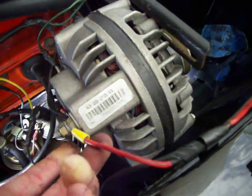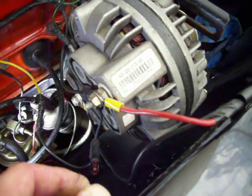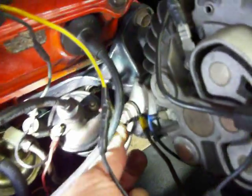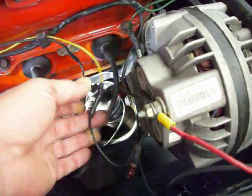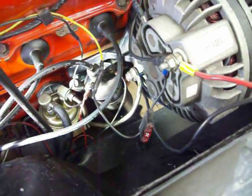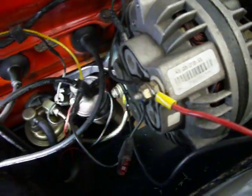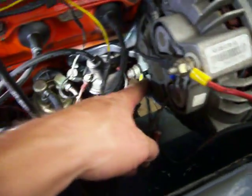The previous owner had the Daniel Stern lighting on the car but didn't upgrade the alternator. This is the red wire here. The black wire just goes grounded down below at the mounting bolt. This extra wire here is for the gauge that I have in the car, and of course that goes up in here. So there are three wires all attached, but basically you might only have the green and the black wire, and then you just create this additional field wire down below.